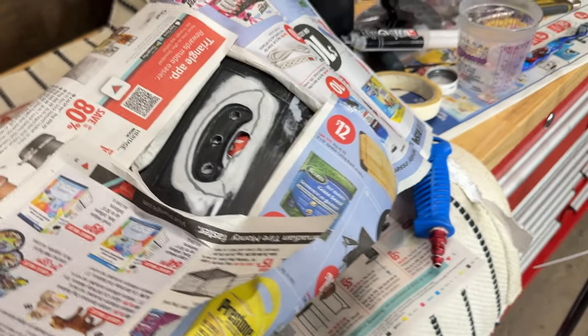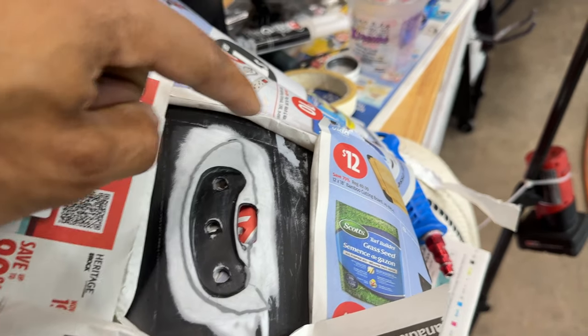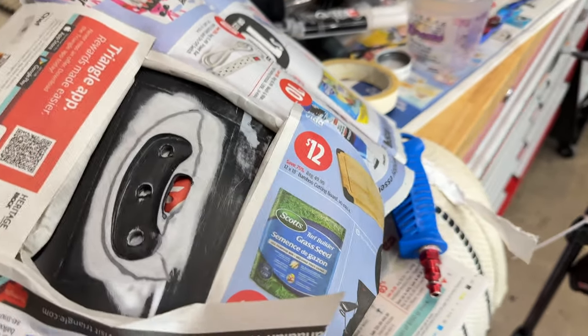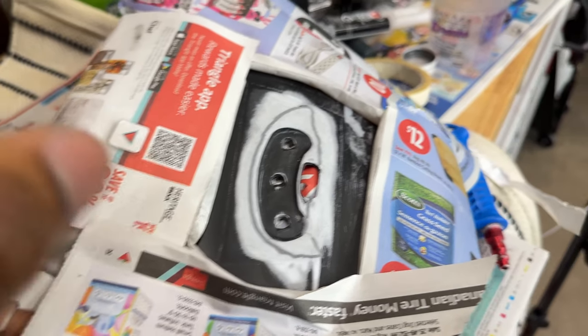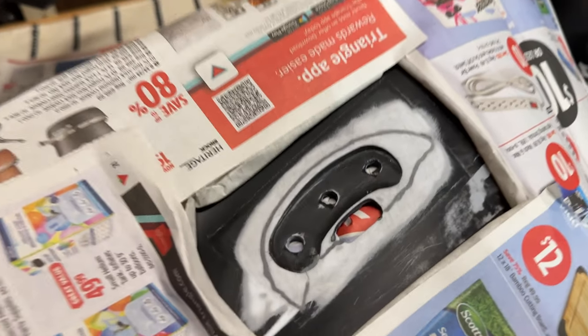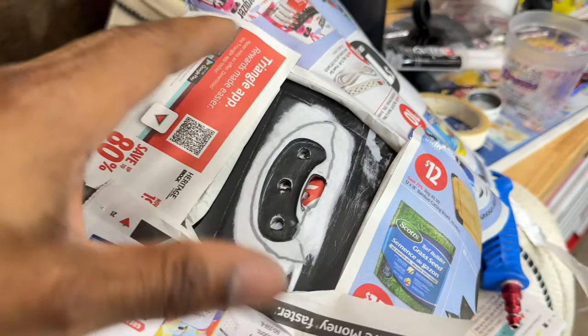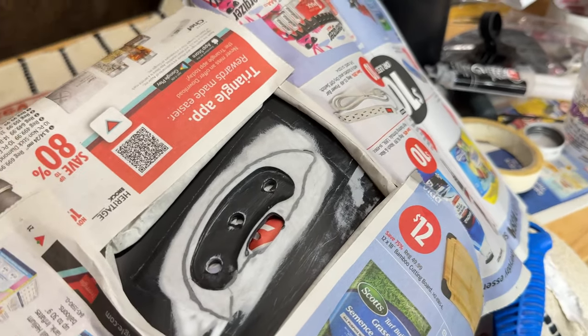When you have to put tape down for painting, always curl it over on itself — don't lay it flat — so you don't get paint lines, because those are a pain to sand out. Curling the tape is the best way to do it; when you sand, there'll be no tape line and it makes the sanding process much easier. This is all ready now — I'm just going to clean it up with some alcohol, put it in the booth, and lay some primer down.